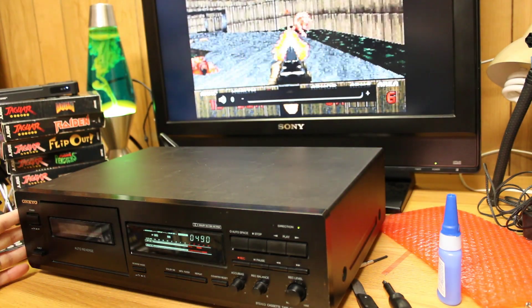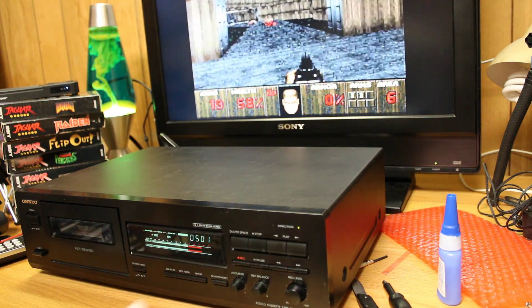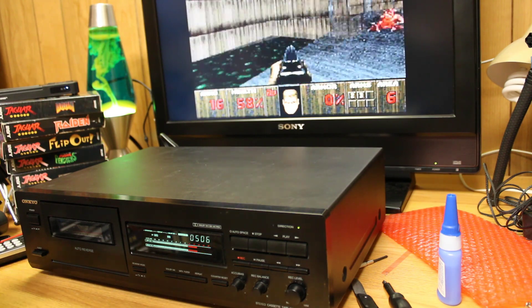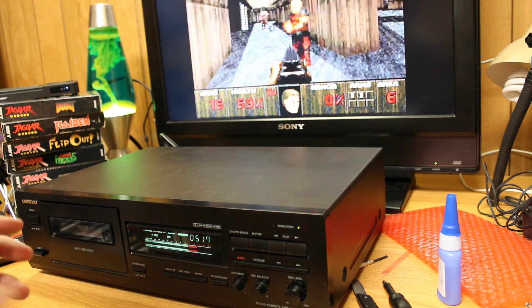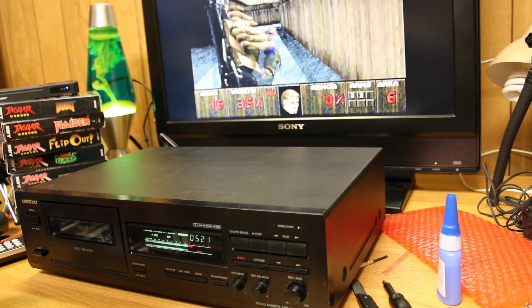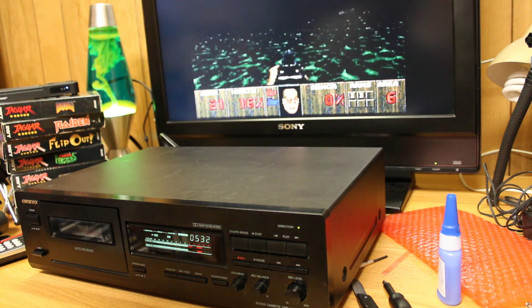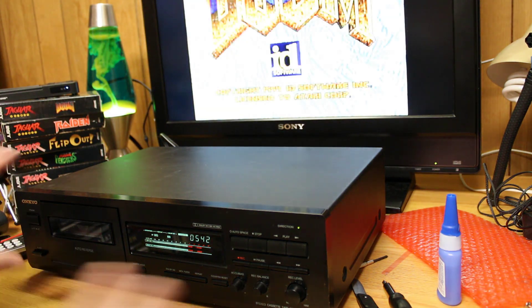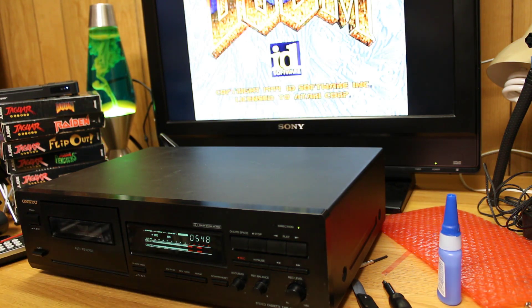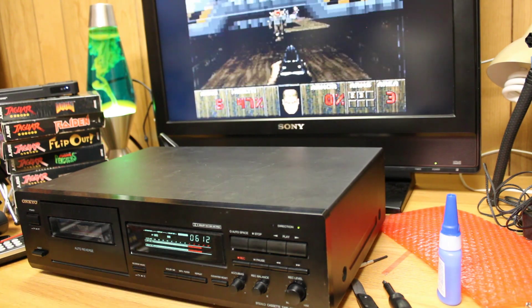So in review, I picked up this nice Onkyo cassette deck for the incredible price of free because it wasn't working. After about an hour tearing it apart, I discovered that really all that was wrong was a gear that had pushed its way in too far, which didn't allow it to operate correctly. The gear itself has a crack in it — I did use some super glue, don't know how long that's going to hold, but I do have some measurements and hopefully I can find a replacement gear. I believe this is going to be a pretty nice deck for no cost at all. If you haven't already, consider subscribing to my channel, and I hope to see you in the next video. Take care and goodbye.